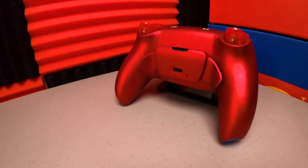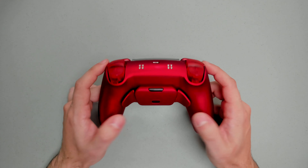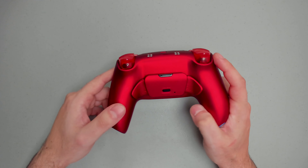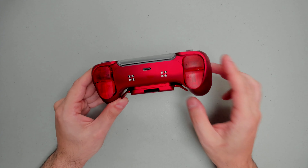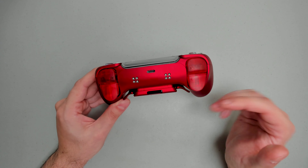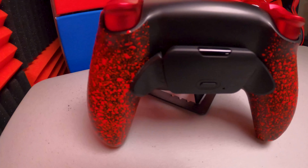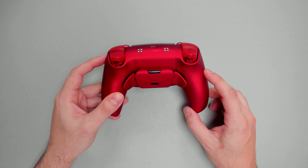The only comment I have is regarding these back paddles. Yes, they are perfectly placed, very ergonomic, very easy to use, and very responsive. But for those of you who watched my tutorial video on how to install these back paddles, you will know that I ended up adding some foam padding to the back of each paddle, giving it extra support when gaming. Because when I press down, it clicks activating the paddle, but I can keep flexing it until it reaches the bottom shell — I don't like that amount of flex. The foam padding definitely helps give it the support it needs. Mega Mods, that can be a future design improvement — and I want credit because you heard it from me first.